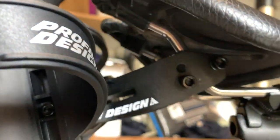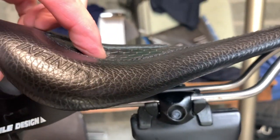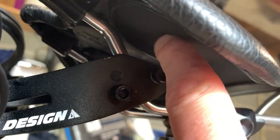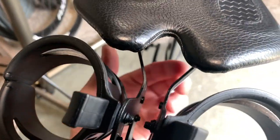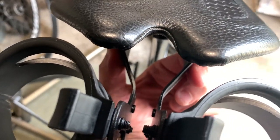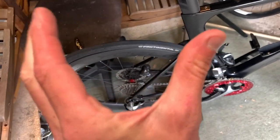As you can see I've dropped them down the back here, because of the design of this saddle where this bit gives, and it was actually hitting under there so I could actually feel it when I sat down. So I've moved them down, and the good thing about that is there are two metal bits here that actually give in a little bit — you can press them in — because the seat rails drop in a V shape, so they're wider at the top than at the bottom, but the metal gives and the two arms squash in a little bit.